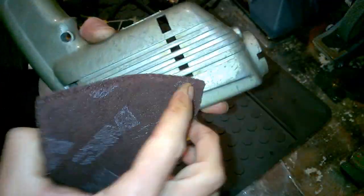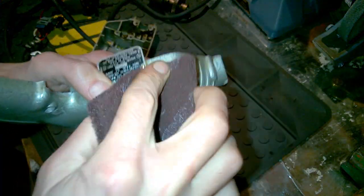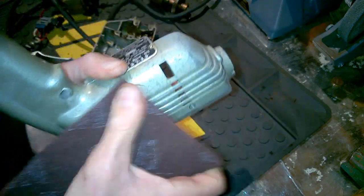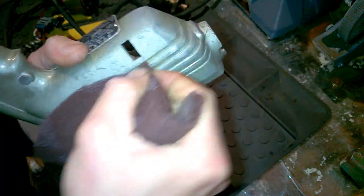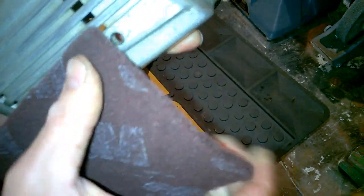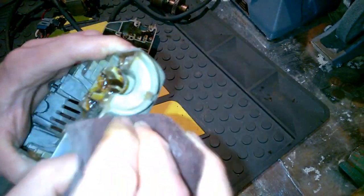Let's scuff this down now. I've got a maroon pad and I'm going to get every nook and cranny I can on this. The idea is to rough up as much of the surface that's going to get paint so the paint will stick — if it's still smooth, the paint's going to delaminate and look terrible. Take your time, go over every nook and cranny, every spot the paint's going to hit. I'm going into the gills here, getting every little bit I can. Paint has got to stick to something — you just need to rough it up a little so the primer has something to bite into. When done, wash it down with mineral spirits and degreaser to get all the dust off, then we'll be ready for paint and primer.